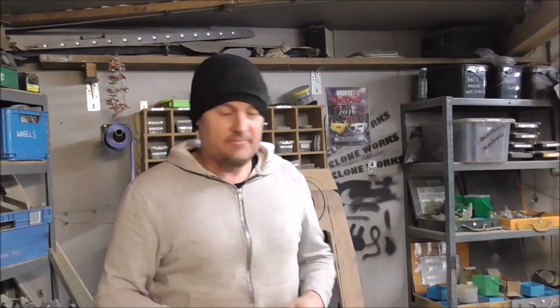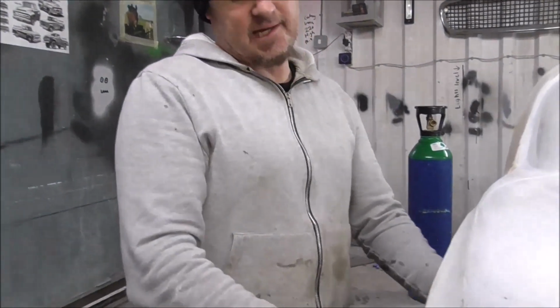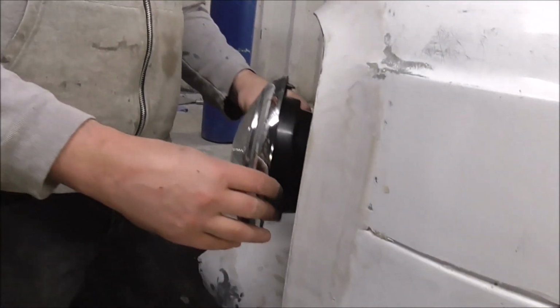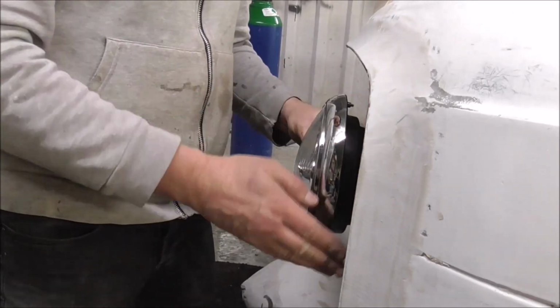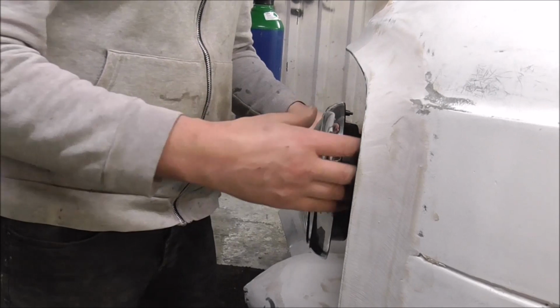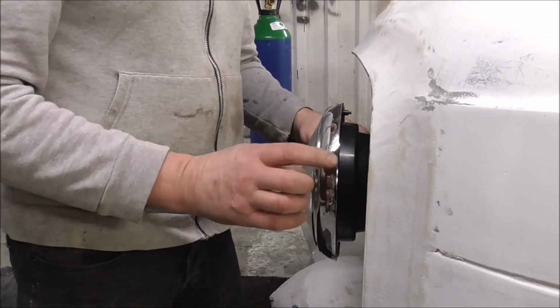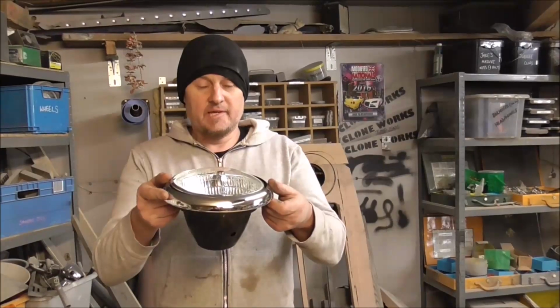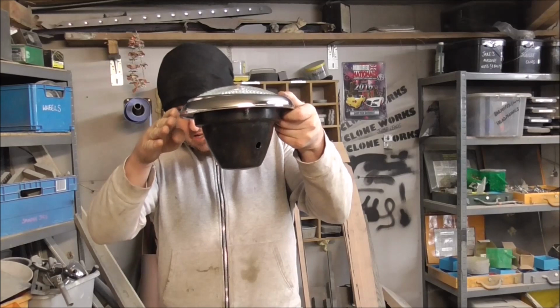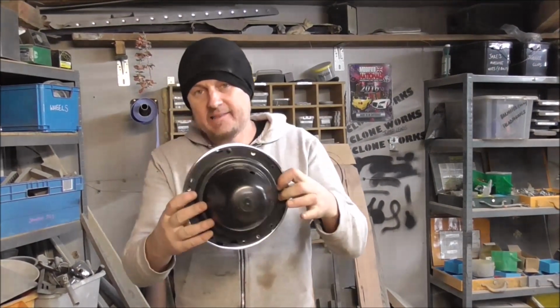I'll just get a headlight. So here's a headlight. So on the truck, it doesn't sit in there. You won't see it from there. It actually sits about just here. And you can see part of that sort of bezel that holds the light sticking out a little bit. So we need to make that bezel. So then we need to mount this on a bezel that sort of follows the line of this trim, comes out a bit and back to about there, and that mounts it in.